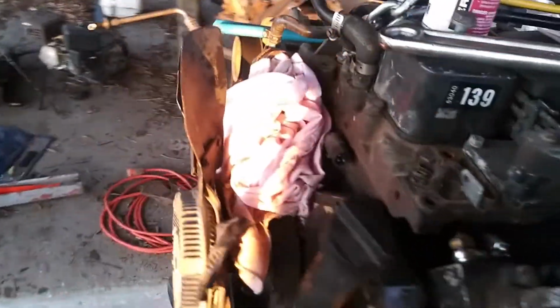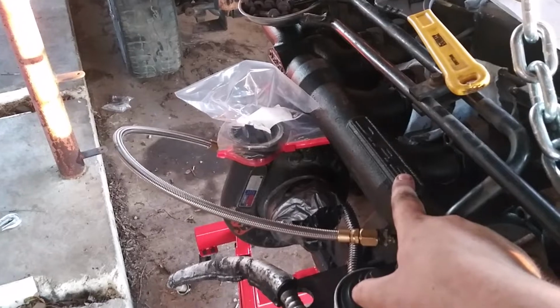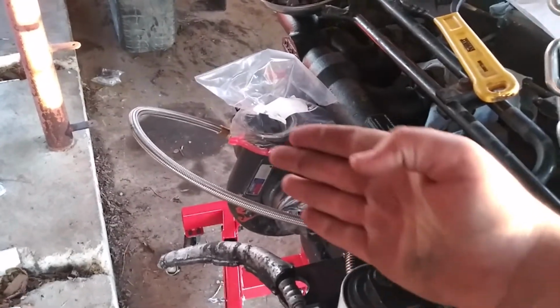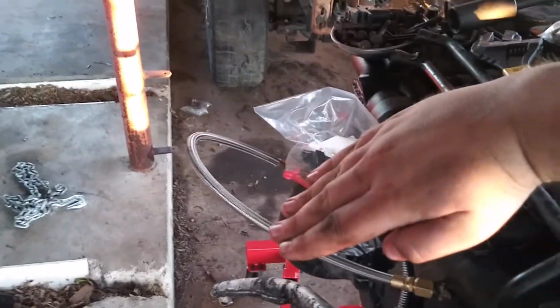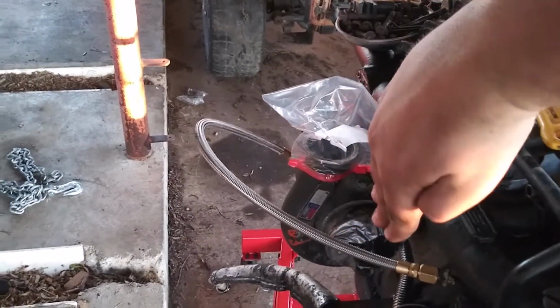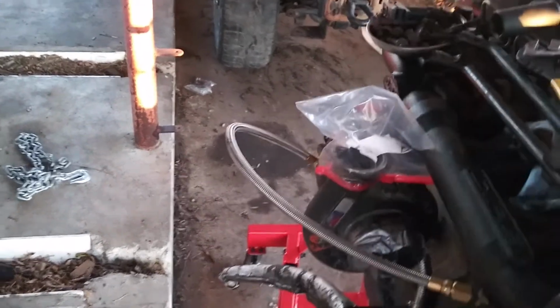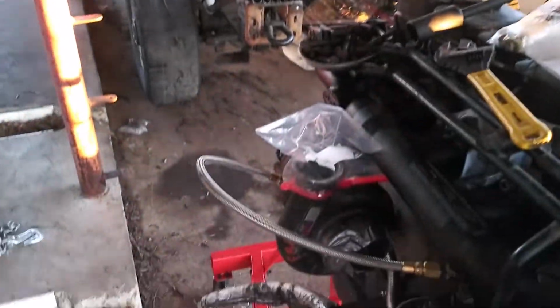And I bought the DCS conversion friendly exhaust manifold. It's a 2-piece, supposed to be better, and it sets the turbo instead of at like a 45 angle to the engine, and now sets it straight up beside the engine, and it sets it 1 cylinder back, so it takes care of the clearance issues with the airbox.